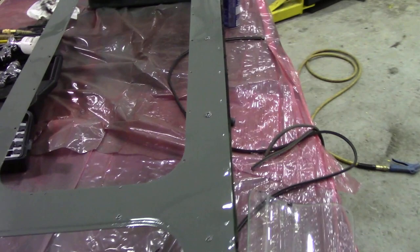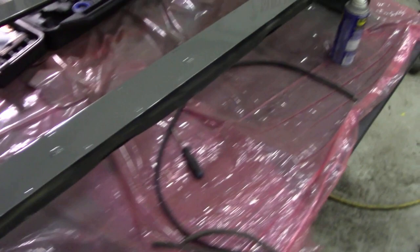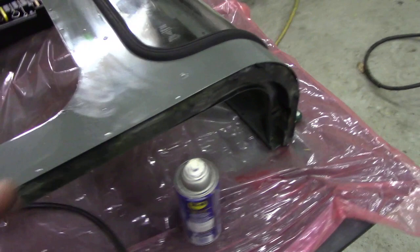The results were quite good if you get the right mix of paint. The urethane paint I painted this with last night called for a ratio of four parts paint, one part hardener, one part thinner — that's too thin, it blows all over the shop. It's really for just a tiniest drop of thinner, and like I said the results were quite good. I hate painting in my shop in winter. I haven't polished this at all, there's a little tiny bit of dust in it but not too bad, and it's on the back of the truck — nobody's going to see it.